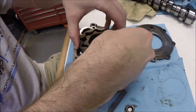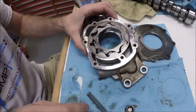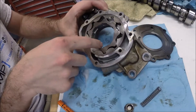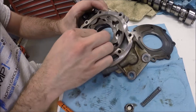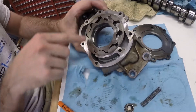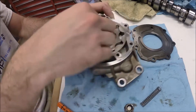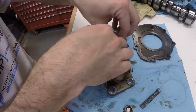Inside of here fits a gear. This is splined and it's driven off the front of the crankshaft. So as this spins, let me show how it fits into the outer gear — it's compressing the oil as it goes around. This is a very precise fit.